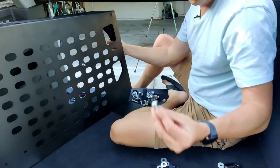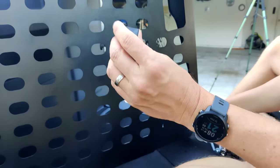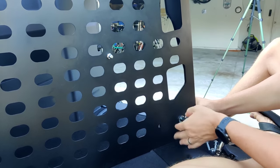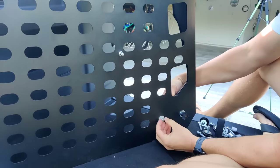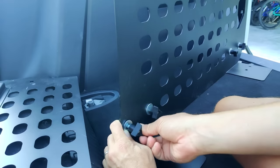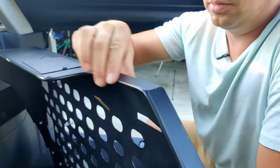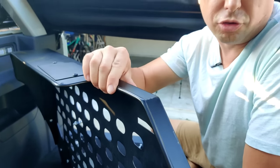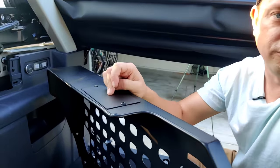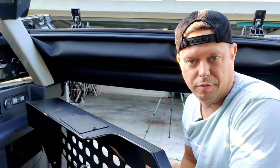To put this together you don't need any tools. Use these bolts — from the back, add a washer, and then a hand-tightened nut. This is the driver's side. It has a nice rubber stripping that protects your interior panel and prevents any metal-on-metal noise. There's also an access panel here — this would be for if you have a hard top and want to route your hard top electronics and washer fluid hose through the top of this.